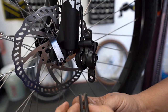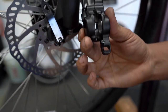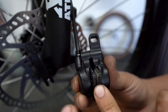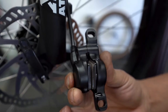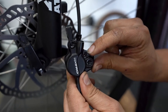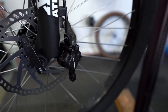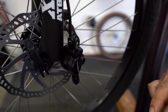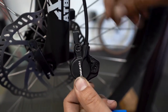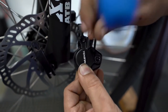You're going to want to pinch the pads together because the spring will actuate. Pinch them, then at a slight angle push them into the brake until you hear it click. Next, we're going to put our bolt into this hole again — grab your three millimeter wrench with your bolt, insert, and twist.